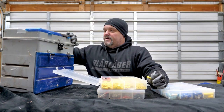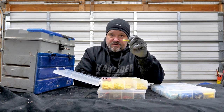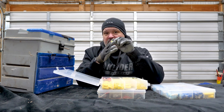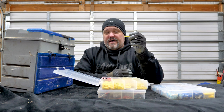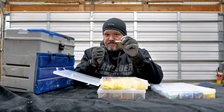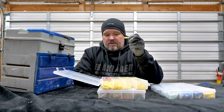One thing I don't have in my kit right now is heat shrink — I'm out. Usually I use heat shrink butt connectors: you crimp it to connect your fitting, then use a heat gun to melt the heat shrink, and you have a watertight connection. After that, I heat shrink tubing over the top of that connection so you can't even see it. That's great for longevity.